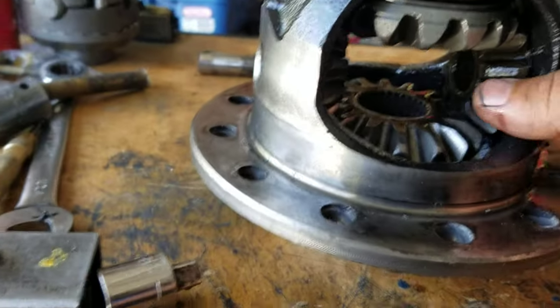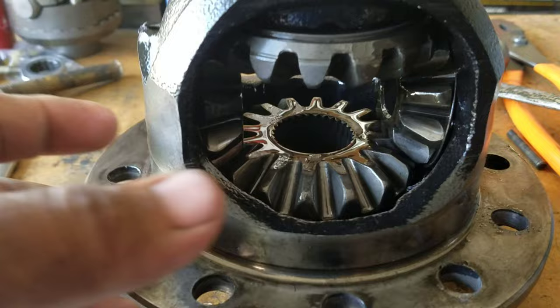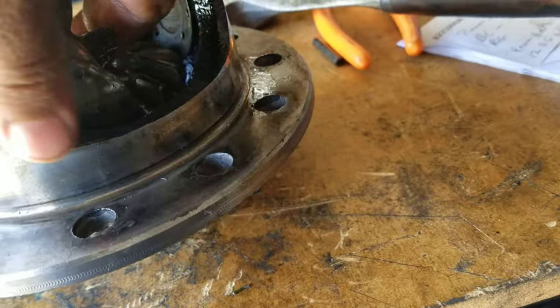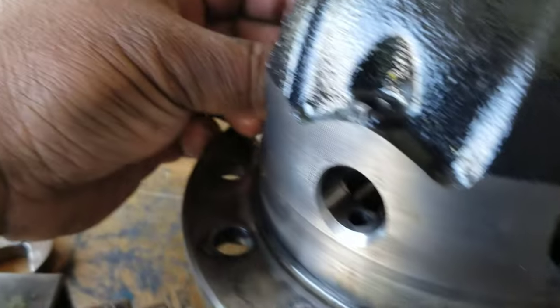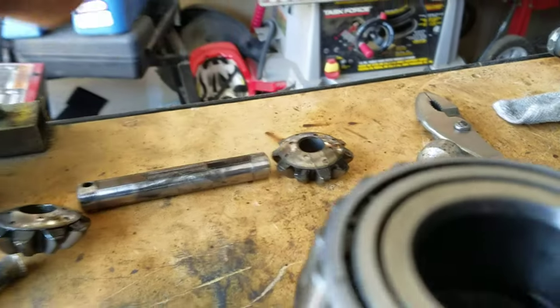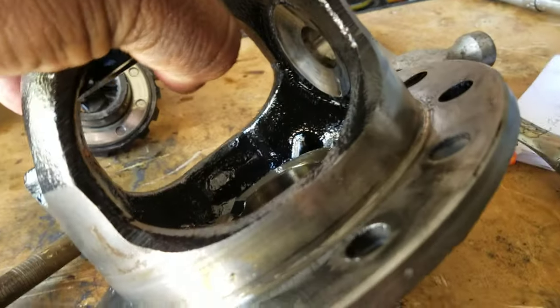This pin and pinion go here. Now that's done, what you need to do is remove the spider gears. This is how you remove the spider gears — you push this one out like this and then it comes out like that. Remember to note the orientation, including the little washer that goes there. The spider gears have been removed and now we just have the housing by itself.